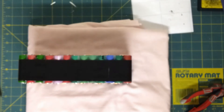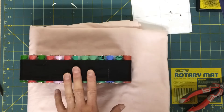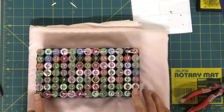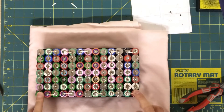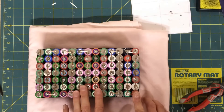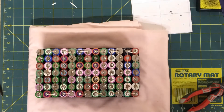On order I've got two BMS modules, one for each of these packs. I've yet also to buy some proper decent-size wiring — probably sort of 10 or 8 gauge I guess — one for each terminal at the end. I don't know how much I'm going to need. I don't know where this will be positioned exactly in the bike yet — either between the frame in the central part, or maybe over the back wheel on a pannier rack. But these are now essentially done. As soon as I've got the BMS I'll solder that on, make a video of that as well, then I can actually charge them.